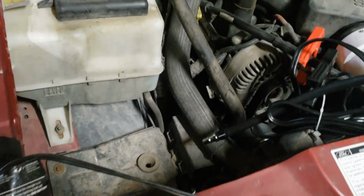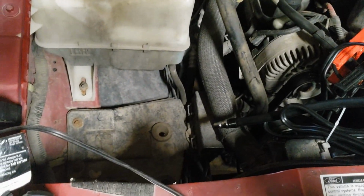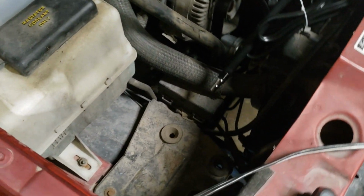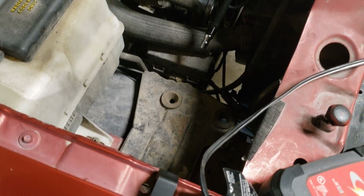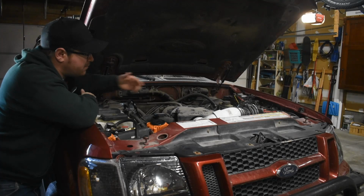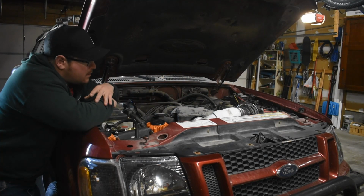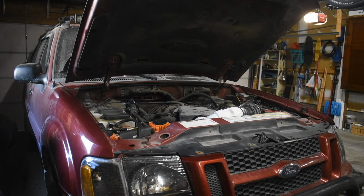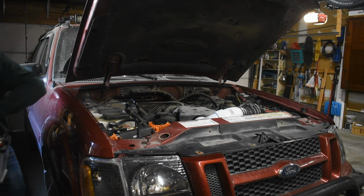I had plans of doing a dual battery setup in the engine bay, but there's not much free space. The decision was made to put the battery where the airbox currently is. This meant rerouting the intake pipe and filter. Easy. A quick jaunt to the local hardware store for some PVC connectors and BAM! New intake pipe. Now there was plenty of space for our second battery. Just had to find a battery to fit.